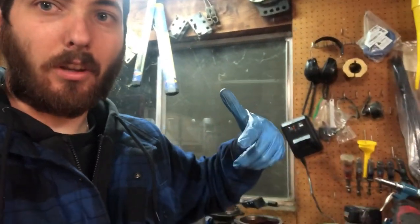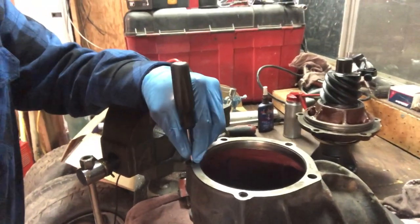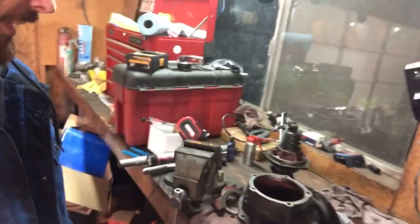I was in a race two years ago and all of a sudden the car just popped out of gear. Literally all the bolts had broken off and the ring gear fell off the spool in the middle of the race. All those broken bolts ended up near the right rear axle bearing, toasting it and scoring up the axle and housing. So I was measuring with my screwdriver - go down into the hole, mark with my finger, bring that measurement to the bolt and make sure the bolt is shorter than that distance. In this case they were, so it ended up being okay.